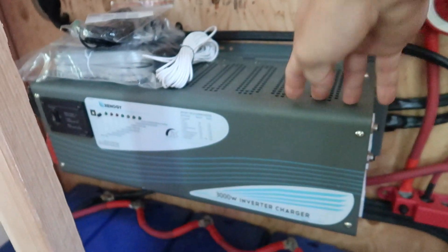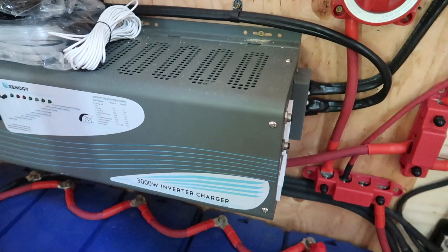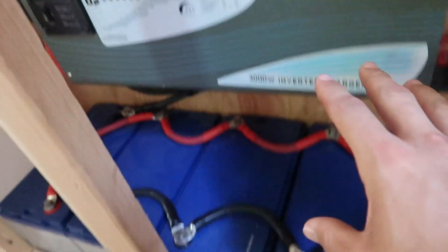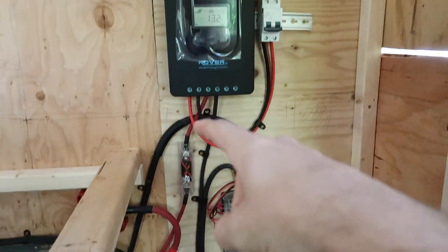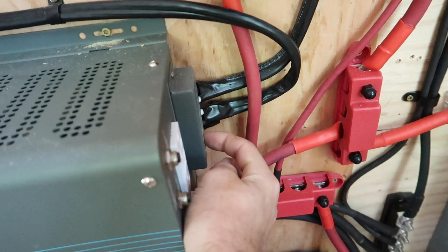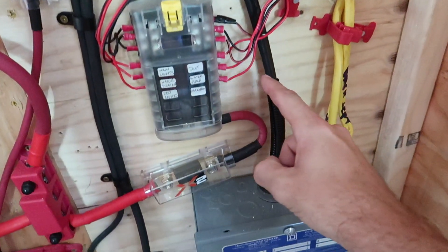Let's talk about the inverter quickly. This is a 3000-watt inverter charger. It can invert the power from 12 volts — which is in our batteries — and convert it into residential power, which is 110/120 volt. The charger aspect means we can plug into shore power: put a plug into the bus and that will provide power, go through here, and charge the batteries. So we have two ways of charging the batteries: solar power coming through these cables through the charge controller into the battery bank, and shore power which comes from this plug outside. That plug goes along this 6-gauge wire into the inverter, and from the inverter it goes along this cable all the way up, around, down, into the breaker panel — which is just like your ordinary residential breaker panel.